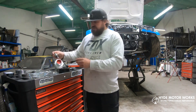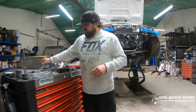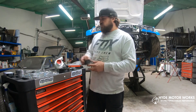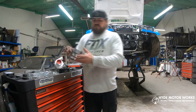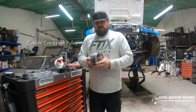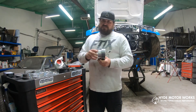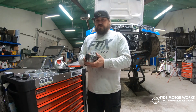The mount plate will also house the pulleys that are needed for this kit, which also come in the kit. There's a small idler pulley which bolts onto the mount plate, and then there's the belt tensioner pulley that bolts onto the mount plate as well. For this kit we've made a new crankshaft pulley — this is a machined 8PK pulley so that we can utilize the entire belt on the supercharger to maximize the grip of the belt.